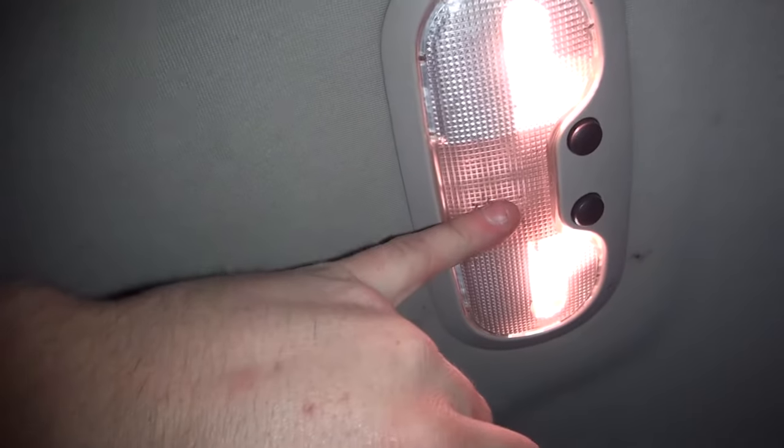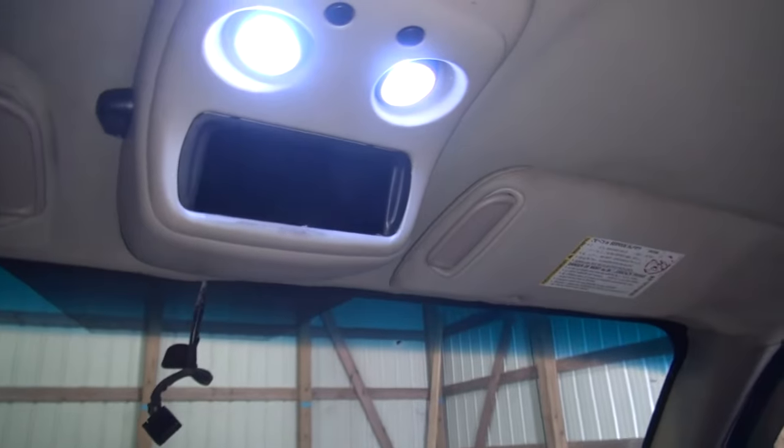All three of those are 578s on this particular truck, and this is a four-door truck. I believe those bulbs are different depending on which cab configuration you have, but on a four-door truck, 578s is what I got. All you got to do is pop the cover off with a screwdriver, pull the bulb out, see what bulb you got, and order a 578 or go to the parts house. Anyway, that's a wrap for this video — thanks for watching, we'll see you guys next time.